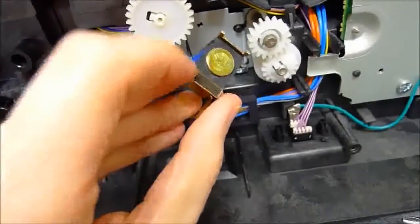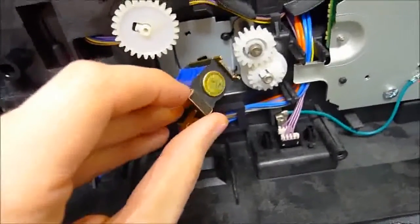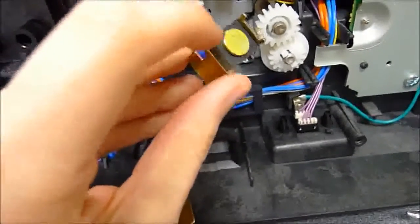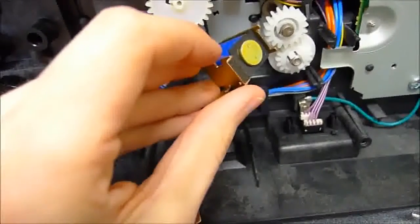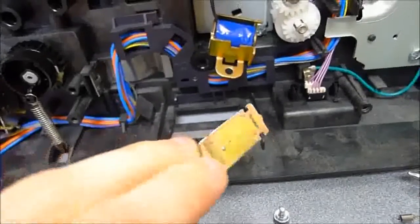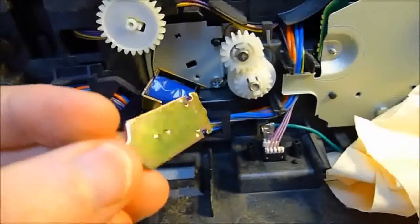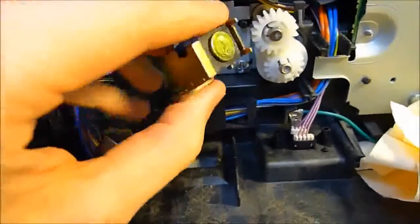Here and here, we need to get all of that stuff rubbed completely off. You can replace it with something — maybe wrap some string or some sort of non-adhesive method. But really, for a printer this old, I'm just going to choose to leave it completely uncovered. It might make a little bit more noise, but at least we can be assured this problem won't happen in the future. So we go find some rubbing alcohol and a tissue and go to work on it. As you can see, we've removed all of the adhesive from the armature of the solenoid and also from the body of the solenoid.